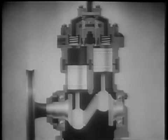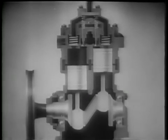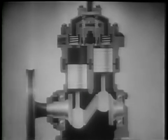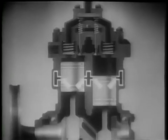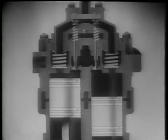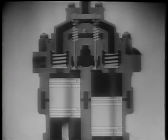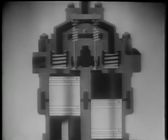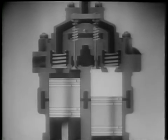The compressor is similar to an internal combustion engine. Most compressors contain 2 cylinders, in each of which a piston is moved up and down by a crankshaft. The holes in the cylinder walls are the air intake ports. The piston serves as the inlet valve by opening the inlet ports to draw fresh air into the cylinder as it nears the bottom of its downward stroke. It closes them to begin air compression on its upward stroke.